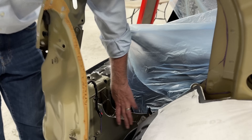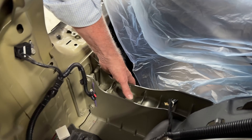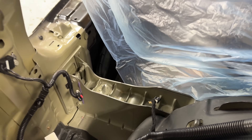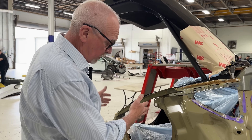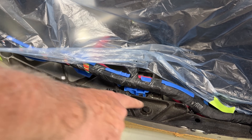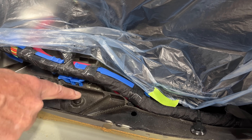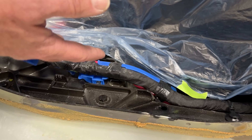If you come back here, you can see through this opening where the quarter panel used to be — our rear giga casting. This is the first version of the rear node or rear giga casting installed. We've posted some videos prior about what it takes to replace some of these. Thankfully on this Model Y, neither node is damaged. With this rear node exposed, if you take a peek at the front end of that node and where it's attached, you'll see two 14-millimeter bolts. Tracing along, this is the ultra high strength inner rocker panel and where the giga casting is attached to it.